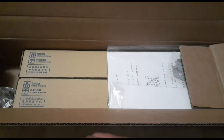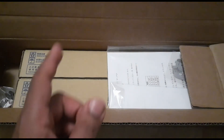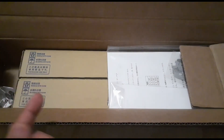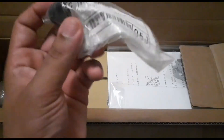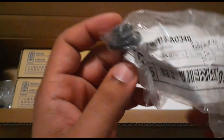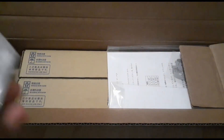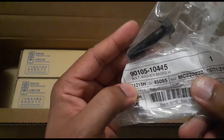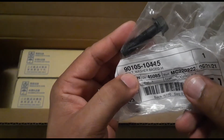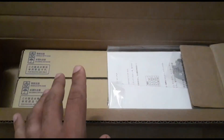We won't be using that tool today in this video — I'm just giving an overview of everything you need when it comes to the camshafts. It doesn't matter if you got the bolt-on semi racing ones or the full-on race camshafts, this is basically everything you're gonna need. I'm getting everything brand new — I'm not gonna be reusing anything that's on the car like always. This is the bolt for the exhaust camshaft, part number 90119-A0348. This is the bolt for the intake camshaft, part number 90105-10445.